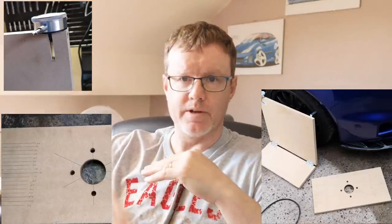To help with that, I've made my own bump steer gauge. You can buy them — they range from £200 to £500 — but I didn't want to spend that. I made this one out of MDF and used a DTI gauge. The picture I'll show you now is just it resting against the wheel for visual purposes. The other piece gets bolted to the hub, with a series of measurement marks. The suspension gets raised and lowered through its travel and the DTI gauge shows the bump steer. I'm going to get a reference from the standard suspension first, take all the measurements, and use that as a target to aim for. There's nothing I can buy to correct bump steer, so we're going to use a unique method — it's been done on other cars, but I haven't seen it done on a Fiesta.